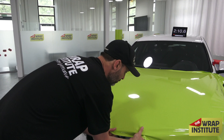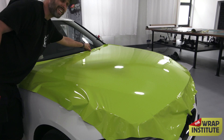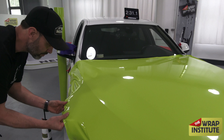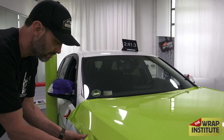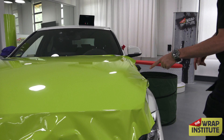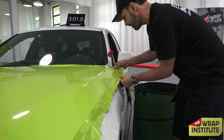It's a really cool concept — so if you're really good at making a bed, you might be a really good wrapper. I'm pulling the material up to here, hooking this corner, and going for a concept I call making glass — when the material has no wrinkles. In this case, because it has a gloss finish, it looks like glass. So the phrase I've been saying for years is: glass means go, wrinkles means no. Wrinkles tell you the material has tension, and if something has tension, there will be issues later on. I fix it by stretching the material a little bit, holding it nice and high, stretching it down. You always want to create glass before you squeegee.